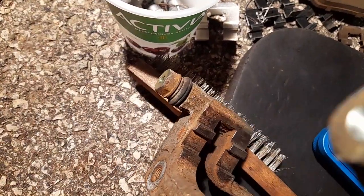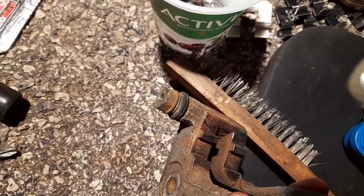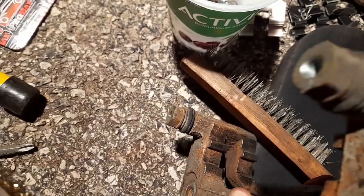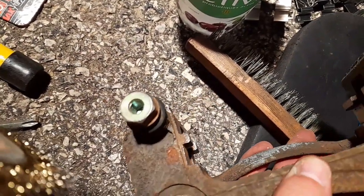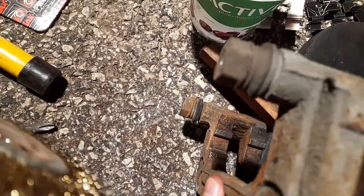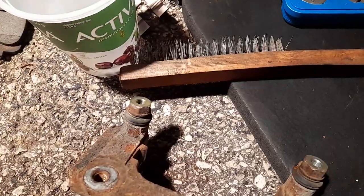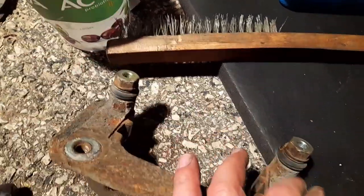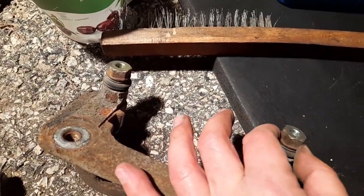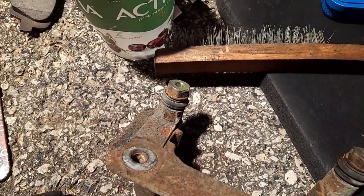At least 10 minutes and it's still not perfect — I'm gonna put grease underneath so it doesn't rust. Because once it rusts and bubbles up the brake pad doesn't move anymore, it gets stuck. The sliders look okay — most people just leave them, but I'll take them out, check them, clean them, put some grease on and put them back in.